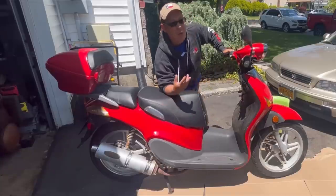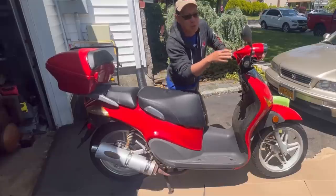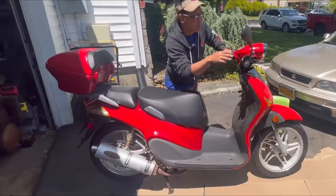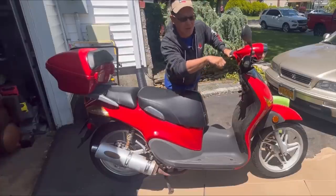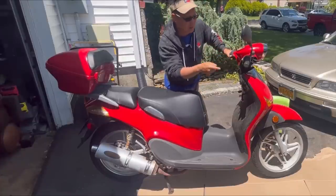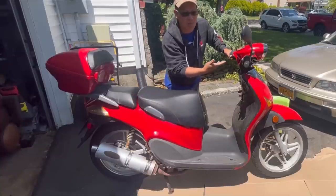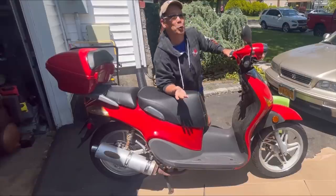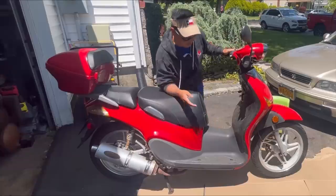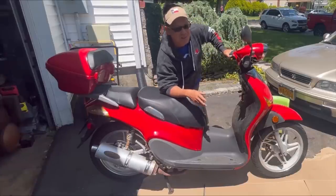But I'm hoping today goes well. It should be very easy. Put the brake levers on there, fill it up with brake fluid, bleed them by getting the air out of the thing. I just hope that the brake line to the rear is gonna be good. I'm pretty confident the brake line in the front's gonna be okay. If not, we're gonna have to order some brake lines and then have to take apart all the plastics to install it, but that would be a pain.